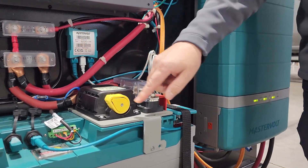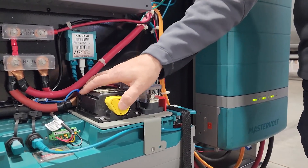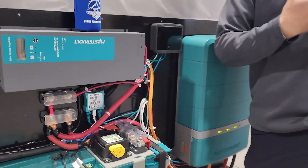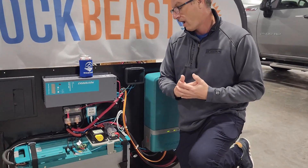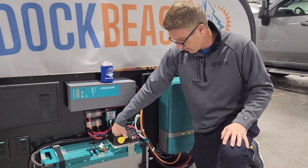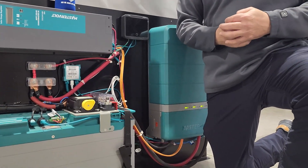What that does is it's a locking collar and it locks this button out from going down. So when you plug it back in, the system is supposed to automatically start charging. However, if you don't flip this collar back, that button will stay locked and you'll get a message on your screen saying 'check relay.'